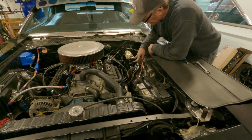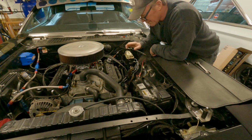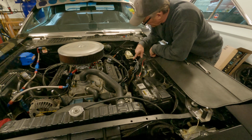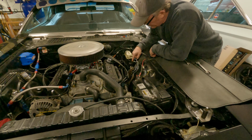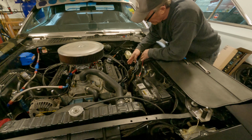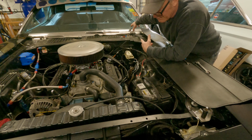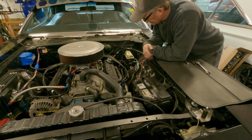So I got a proportioning valve. For disc brake cars, you guys know, it limits the pressure to the backs, and it's a combination prop valve distribution block. What I was thinking about doing here was going back to the 70-71, this is the first year for this. In 70-71, they just had a brass block where everything went in and out, to the back and to the front, and they had a hold-off valve and also another valve, and there's two other valves that would be in the back. Still available. This is not available.